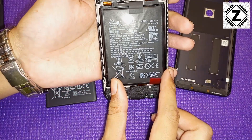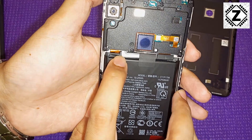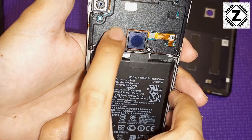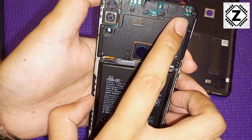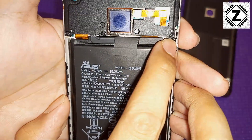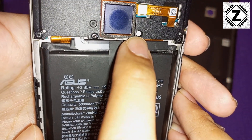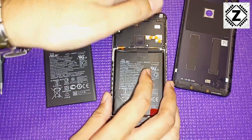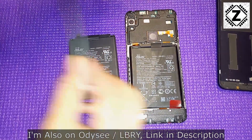Here is the battery and we have to remove it. Unlike older phones where battery replacement was a two-minute job, here we have a lego-style connector which is under this plastic motherboard cover, secured by around eight or nine screws. There is also a warranty screw hidden under a white sticker, but since this phone is from 2017 or 2018, warranty is no longer a concern.